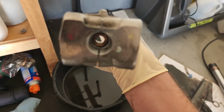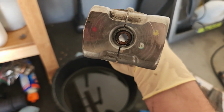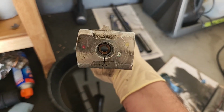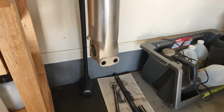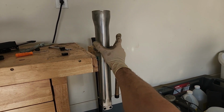Scoot your eyes down. There's a little washer in there. This little washer's a crush washer, it's copper. That little bolt that we took out slides in there. And I imagine the manual would tell you to replace that, but I didn't buy that either. So I just went ahead and cleaned this up a little bit. I'm gonna put it right back here, and I'm gonna show you how all the bits fit into this fork